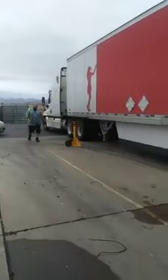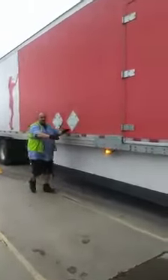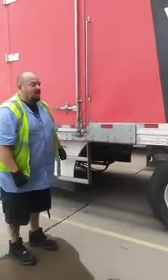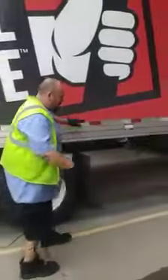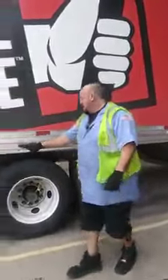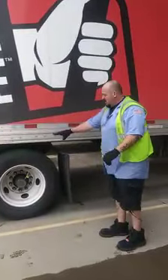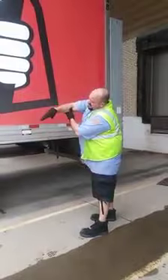Since the weight is all right here, I'm going to bring some of that weight to the back wheels. Now that my wheels are slid forward, I'm also going to be able to turn tighter and sharper in the parking spaces. The more weight I put back here, the more weight will go on the back wheels. The closer I slide these back, the more weight that's going to bring to the front. So if I had a really heavy load and it was too much for my back wheels, I'd slide that back and make that weight go on the front wheels.